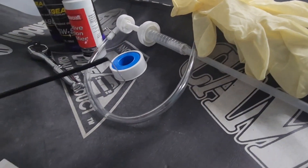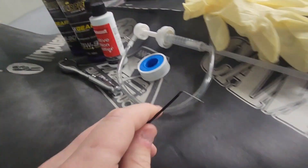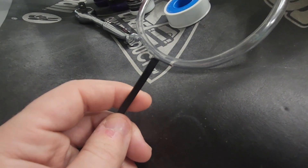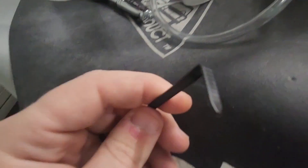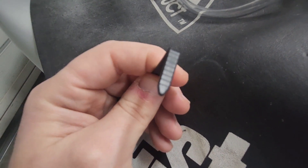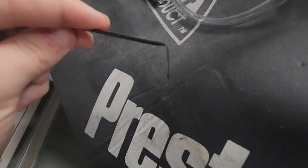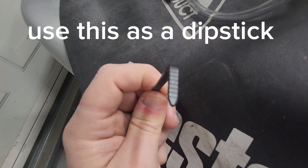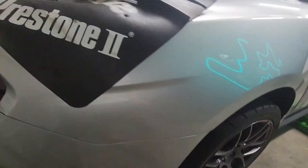You may be wondering what you need a zip tie for. The service manual says that when you're filling the fluid it needs to be nine millimeters below the hole. Not all zip ties have these markings, but basically once you put your fluid in, you're going to stick it in the fill hole and you want it to sit between the fourth and fifth lines on the zip tie — that gets you as close as possible.